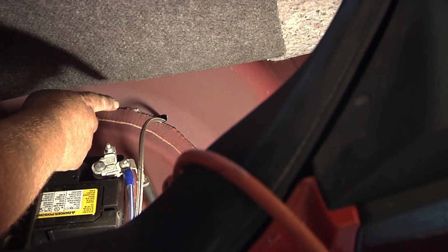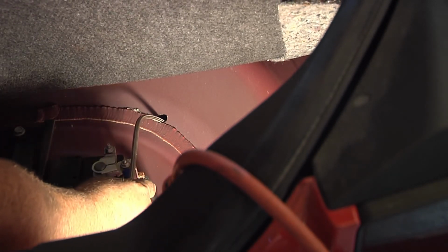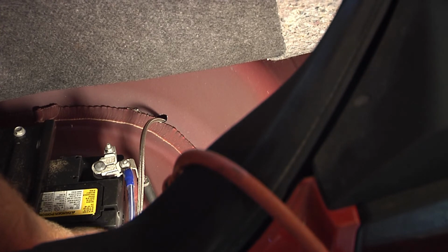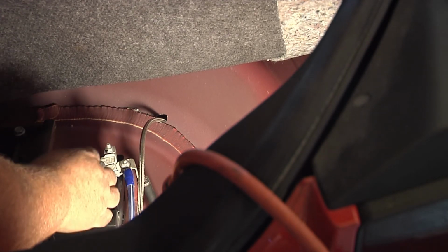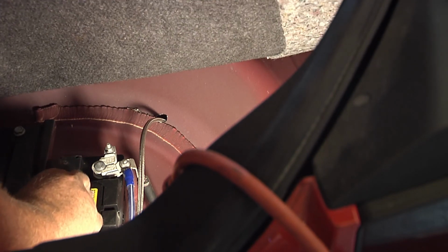But I had to drill a pretty good sized hole. That's bigger than a ½ inch. I drilled it out to ½ inch and wallowed it out for this fitting to fit through it. And I'll put that wiring loom through there to help protect that line. You don't want to leave it like that, leave sharp edges. I'm just going to put some tape around it for now.